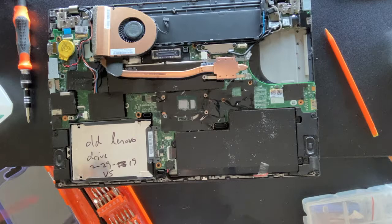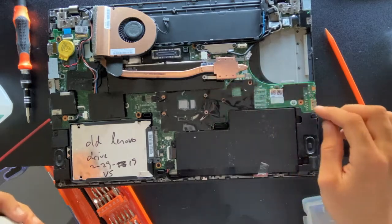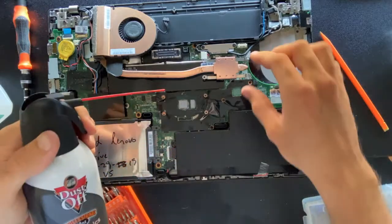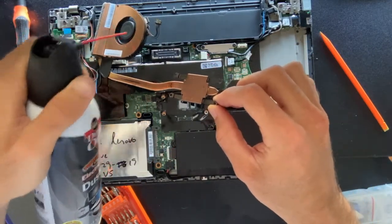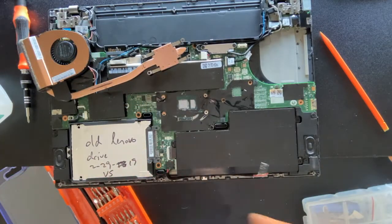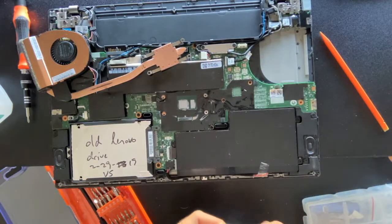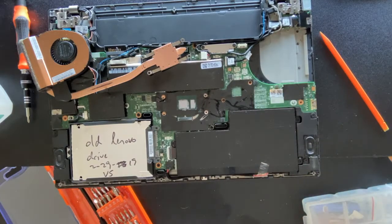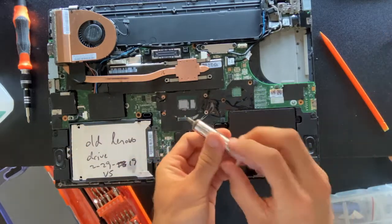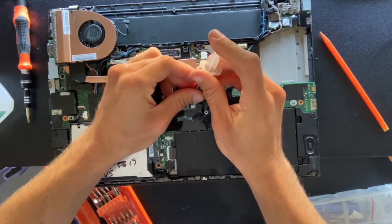That's why I use ethanol — don't use water because water is conductive. Ethanol also evaporates very quickly, which is great. I was just blowing away any residual bits around the die to get as good a contact as possible between the CPU and the copper heat sink. Then I've got some Arctic Silver 5, and after one last good clean, I'm going to put about a rice grain's worth of volume onto the surface of each die.